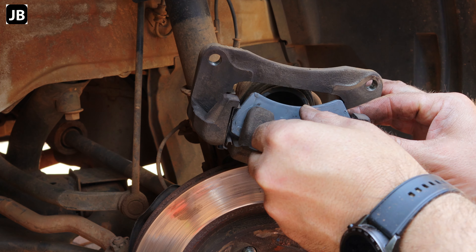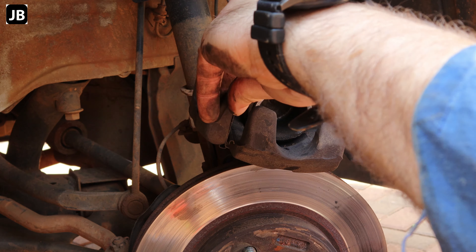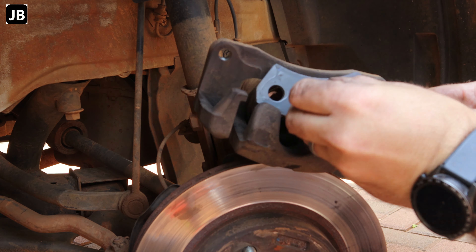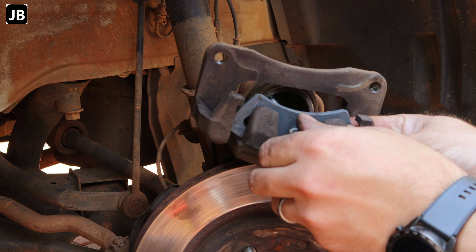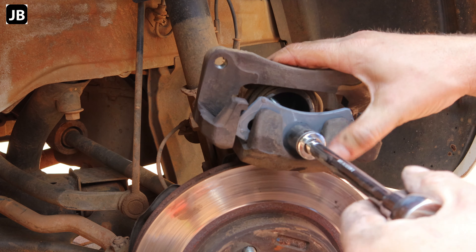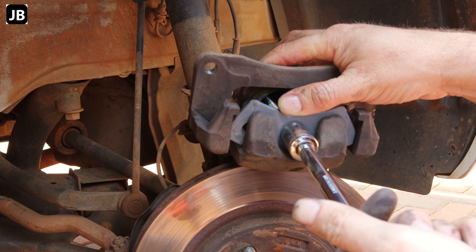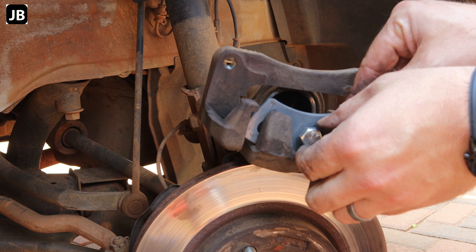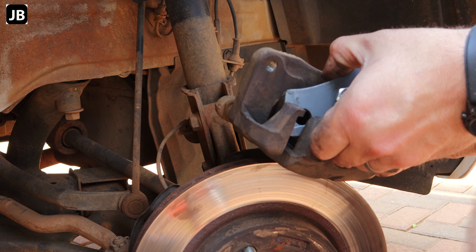This time I remembered my little compression tool. Take out the retainer clips, then chuck in the little tool. This time you'll see me go very, very slow — I'm watching over the bonnet into the brake fluid reservoir. I'm right on the edge; can't compress it anymore otherwise it'll start leaking in the engine bay.